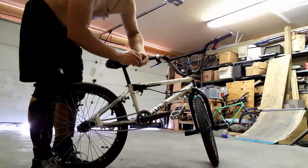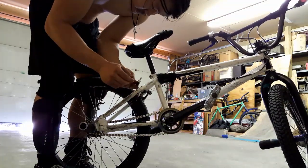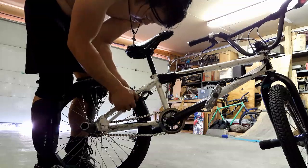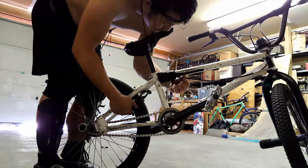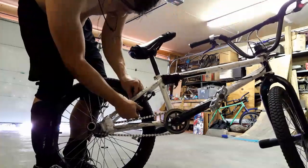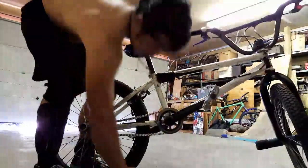We're going to put our brake pad on — let me get a little closer. Okay, so we're putting the brake pad on. Actually, I have my brake pads on opposite — let me fix that. So we'll put them on like this. Sometimes you need to adjust this down because your brake pads are so worn that you've had to readjust your brakes. There we go — now we're simply going to put these spacers back on.